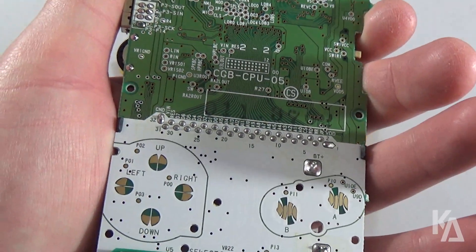That will ensure that you can fully close up your Game Boy Color and there won't be any weird spaces or gaps. You'll also need to align the screen inside of the housing, but other than that you're not getting rid of any screw posts, so you'll still be able to screw in all six screws that go into the back of the Game Boy Color — which means you can reopen your Game Boy Color and take everything out if you choose.